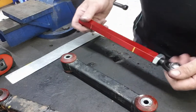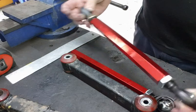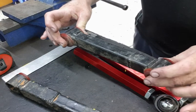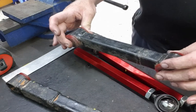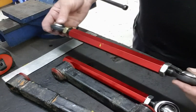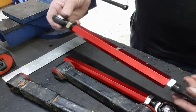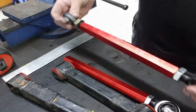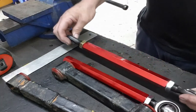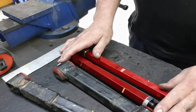Pretty sure it's around $130 to make two upper arms - you can't even buy genuine ones or the bushes close to that price. Once these are done they're going to be great - they'll just let the car move where it needs to, up and down, compared to just stiff like it was. Even with the pan-hard bar taken out she was just rock hard. Hopefully this is going to help a lot, free everything up. Every time I race I think about the damage from hitting holes - I just want to forget about it. Next you'll see me chopping these and making the mounts.